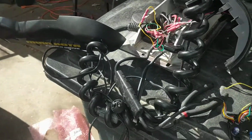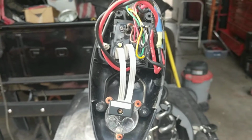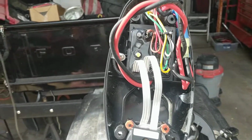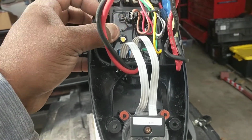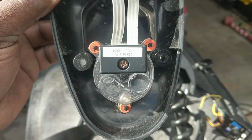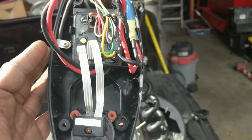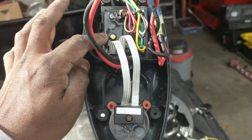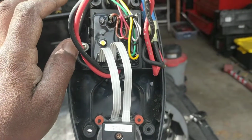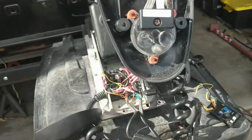Motor's a motor in the bottom basically, but all the guts of the power drive are actually upgradable. So in the head, this is your autopilot here. So little button over here, if you hit your autopilot, there's your mechanical compass. This is what keeps you on track. Now if your older power drive has a mind of its own and you turn the compass on and it starts going left and right, most likely this board is bad. They're about $125, $130, pretty easy to replace.